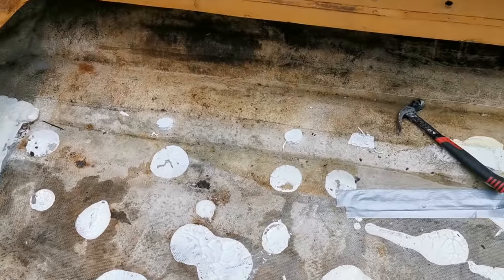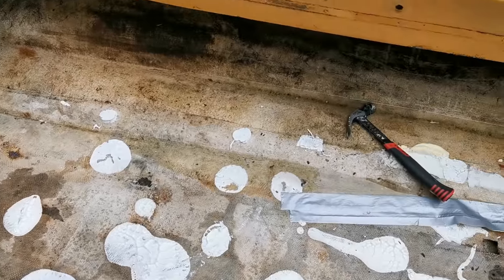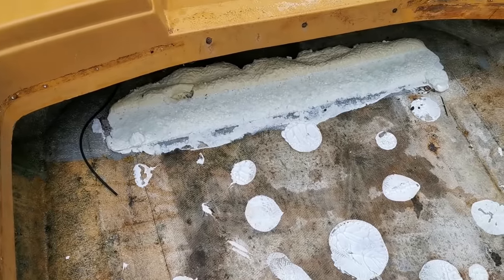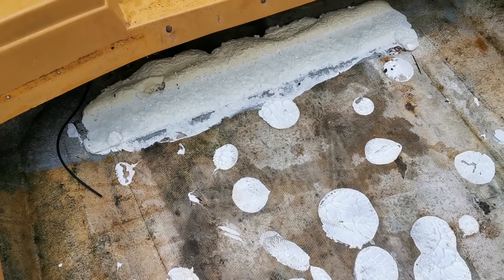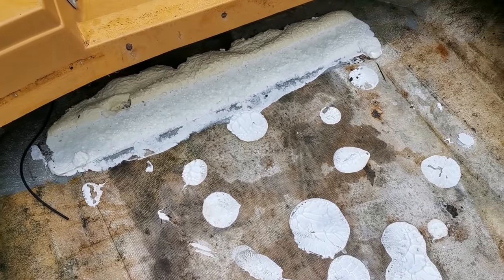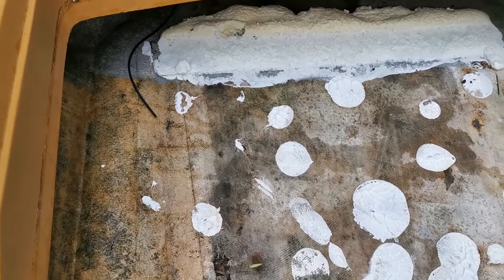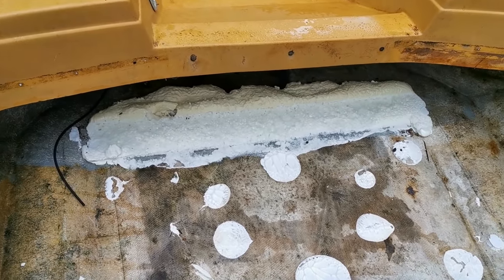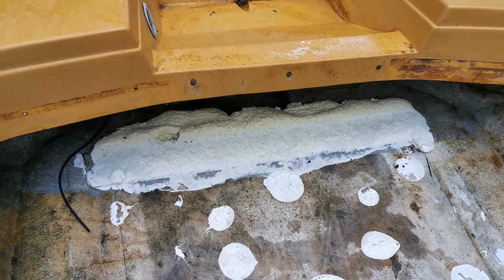But yes, as suspected, all rotten. I'll probably do it a little bit differently — maybe put it through a scantling calculator and see what it needs to be, or probably just do it by guesswork. But it might get a few more stringers than the standard boat had, and foam fill it as well — not with dodgy builder's foam but with proper closed-cell polyurethane marine foam.